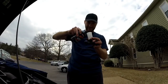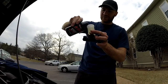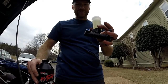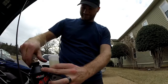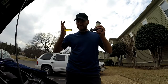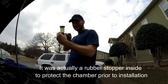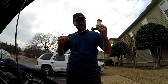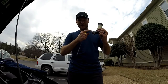We're going to fill this to about the max line, maybe a little bit more. The reason for that is because once you hook the lines up and start bleeding the system, it's going to pull more fluid through the lines, so you'll end up having less. You want to double-check that, top it off, and make sure you aren't running out — otherwise you'll get air in the system and have to start all over again. Once you pull it up, put the cap on it and take a long Phillips head screwdriver and punch it in there. I think we just saw some fluid shoot out past my head. That gets rid of all the air that's in here and allows the fluid to come down inside the chamber. So once we start trying to pressurize the system and remove air out of all the lines, we'll have no issues inside here.